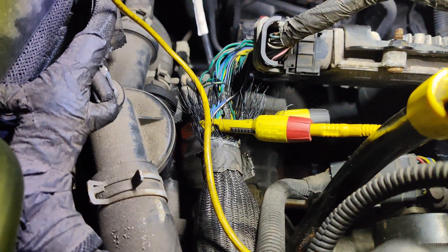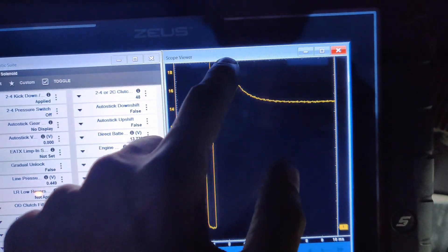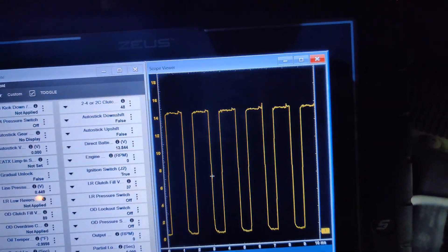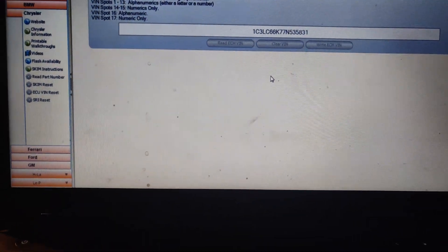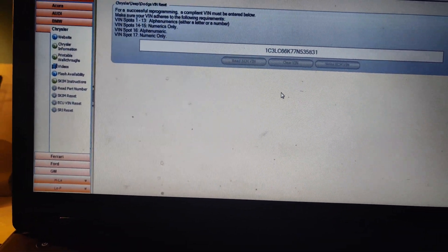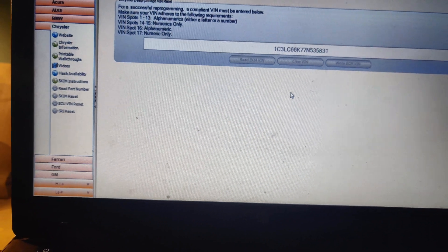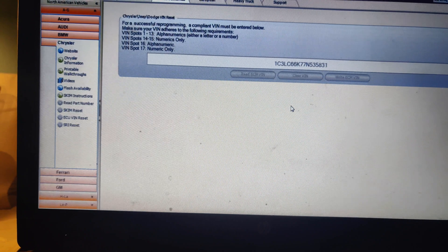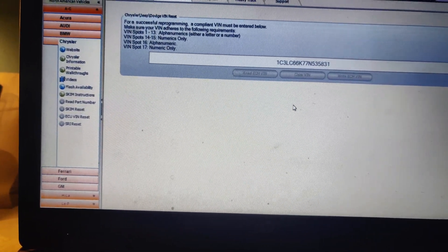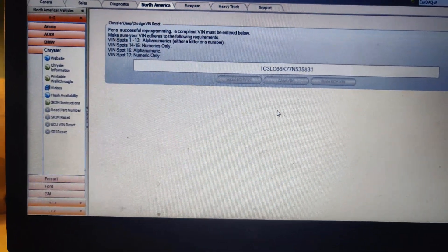We're connected back on here and I have it triggering — this was the bad solenoid and now the solenoid's being commanded on and it's both modulated, so we fixed it. I just wanted to add that I did a quick relearn in the car and the car drives perfectly fine and the customer is really happy. I hope you guys liked the video — I'm going to link in the description to Brian Mann's video on how to use used Chrysler PCMs. Check out his stuff. See you later.